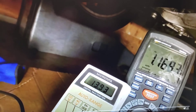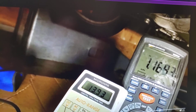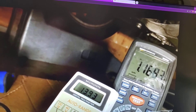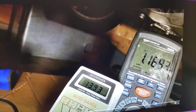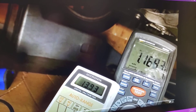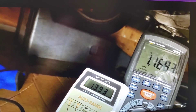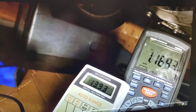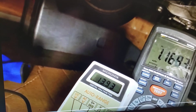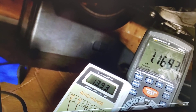In the OBD11 app there's also an output test function you can execute under the engine. The test is called something like 'Coolant Control One.' When you execute that test, it basically turns on the fans — both fans — and within 15 seconds the fans start out at a slow speed and then increase every second to the point that they get really loud, all the way to full speed. At full speed, the voltage on that little green wire gets up to 8 volts. So that little green wire controls the speed of both fans.